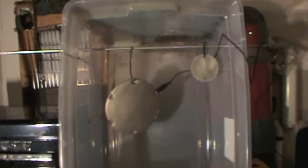So again, the process is to, and I'll use these two things that I'm going to powder coat next as an example, get the parts blasted, get them good and clean, get them down to bare metal. Handle them very little. You don't want to get your hands all over them because the oils from your hand will stick to the metal, and then if you try and powder coat over that, the powder won't stick and it'll just bubble up and flake off. So try and handle it the least amount of times as you possibly have to.